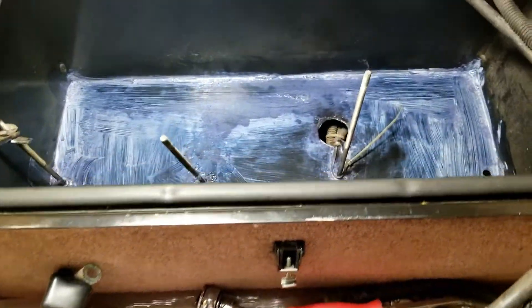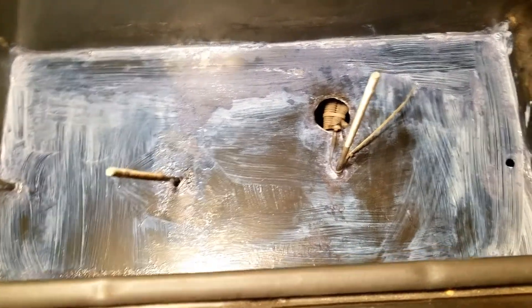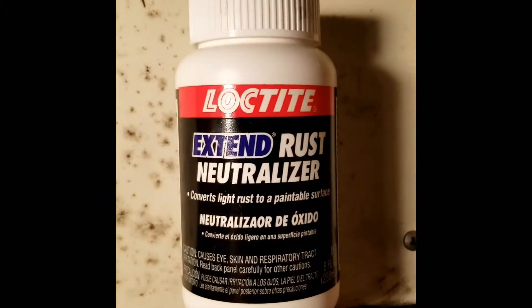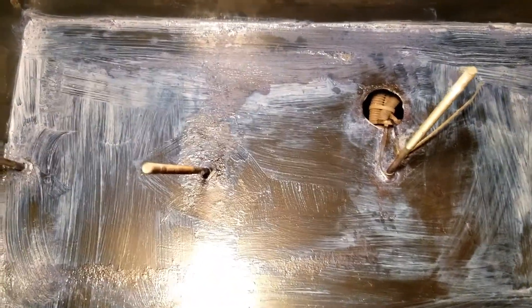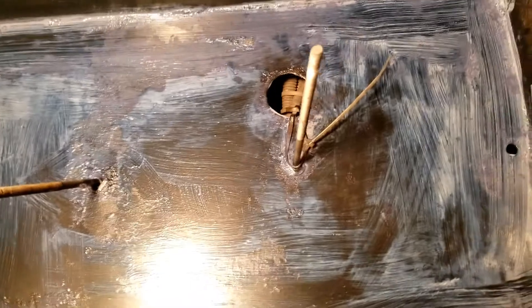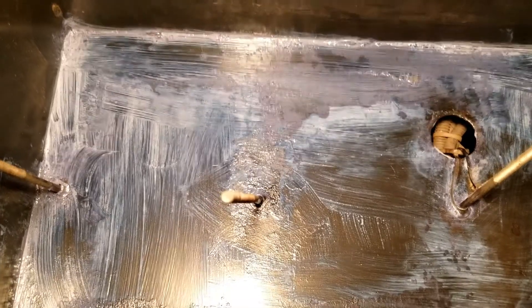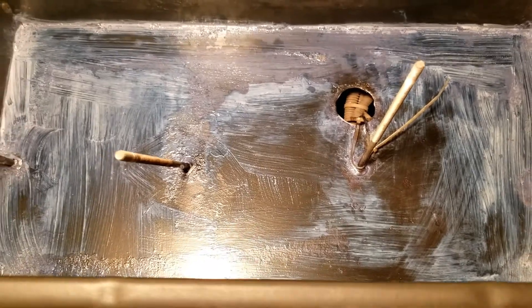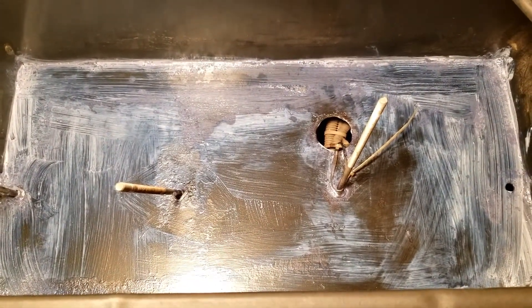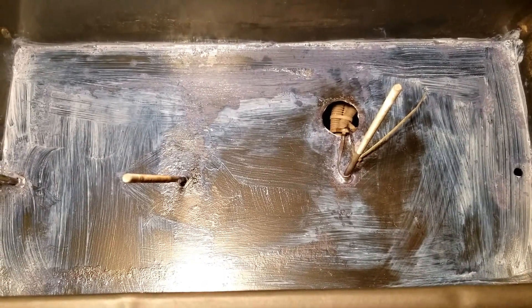We finally got around to getting this battery box primed with rust neutralizer. Again, it wasn't bad - just surface stuff. This is what we used - it's the first time I've used Loctite Xtend Rust Neutralizer. Pretty good stuff, brushes on, goes on like a light gray and will turn black as it dries. The neutralized rust also goes from like a purple to a black as it dries. It's brushed on - you can see the brush strokes, but believe it or not when it's dry you don't see them. Probably tomorrow we'll get the top coat of lacquer black put in there.